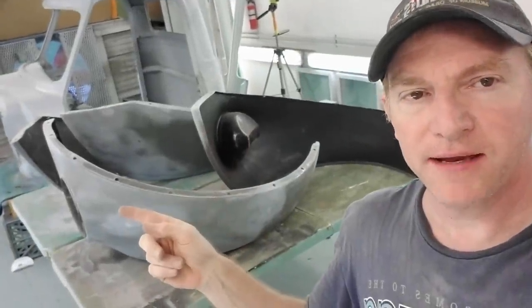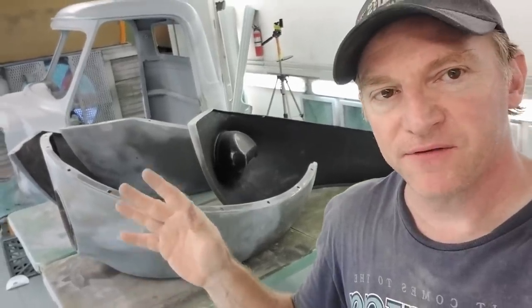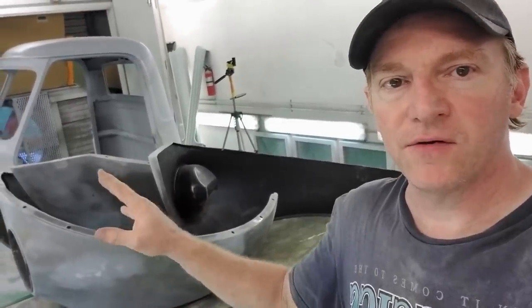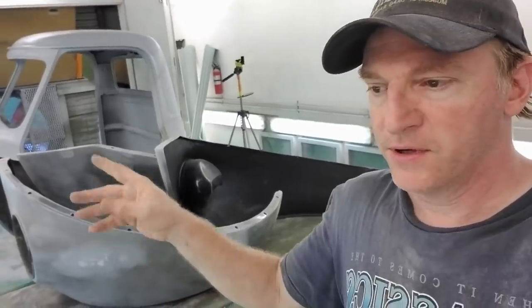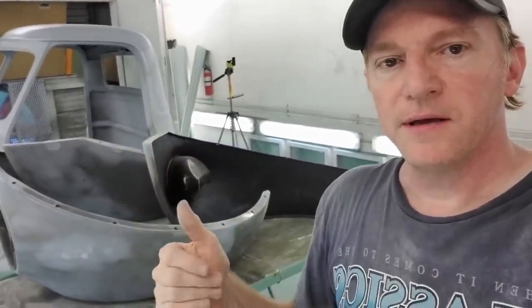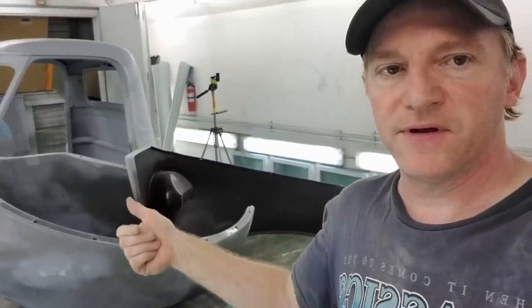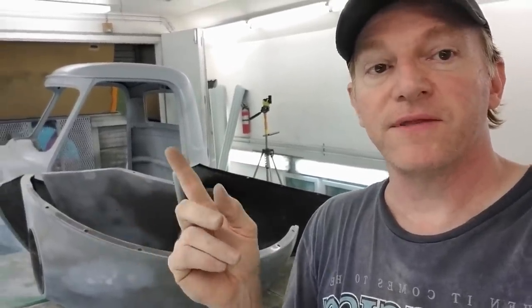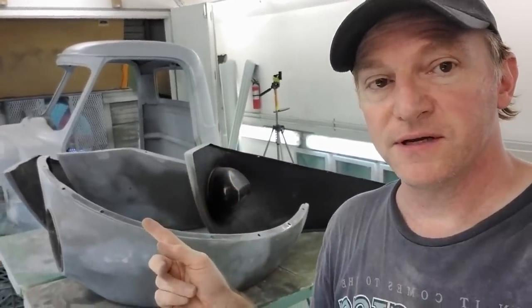As it stands right now, we are at a point of completion for the day — it's past five o'clock. We have the outside, all the spider cracks taken care of on all four fiberglass fenders for Eleanor. We were able to grind down all the spider cracks, a couple hit marks and whatnot. We were able to put the Kevlar glass in, sand it all back, and now we're ready to go after the gel coat and the matting we're going to put in behind the fenders, because we have two areas of actually broken fiberglass. Once we get those repaired, the fenders will be just as good as new and we can primer them out. Thank you for joining us today and checking out Eleanor's fenders — we'll see you on the next vlog.